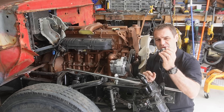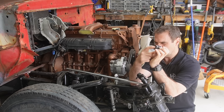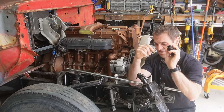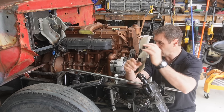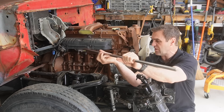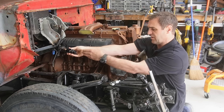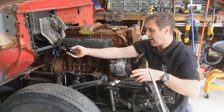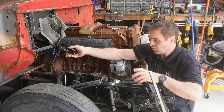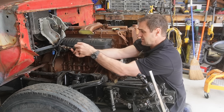There are components you can get that are engineering legal - already tested and proved to be safe enough to use. I've got these universal joints that are engineered, tested and legal. This one goes from the Toyota spline - I think it's a 36 by 17 spline - to a double-D shaft, which is a bit of round stock with two flats on it. This is also deemed legal. So the Toyota steering spline will be used to join up the bottom of the shaft to a universal joint to double-D shaft. The issue is there can't be more than two universal joints in line without support in between, otherwise they'll just flop around, so I need to add a rod end up here.